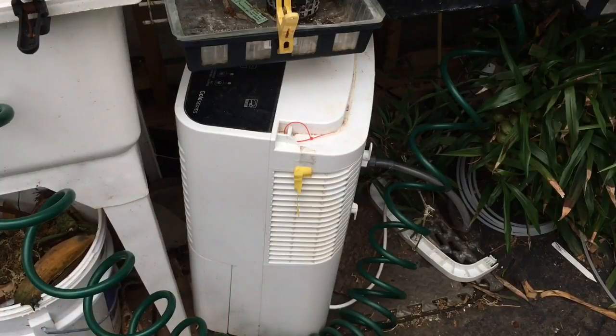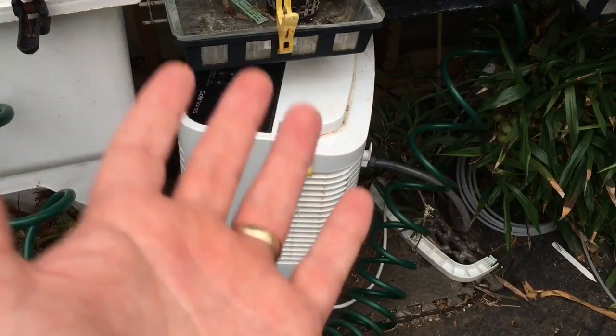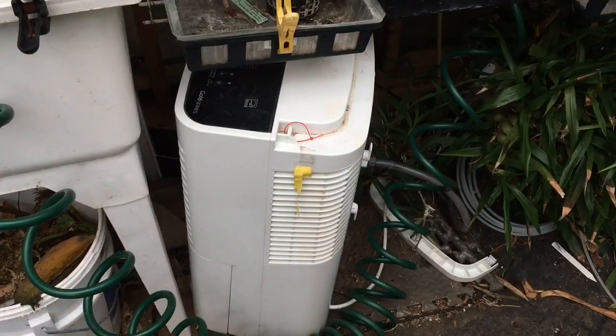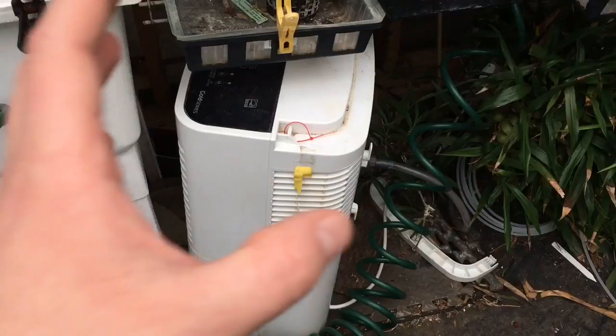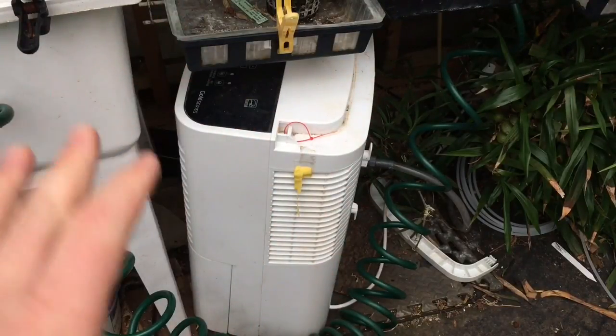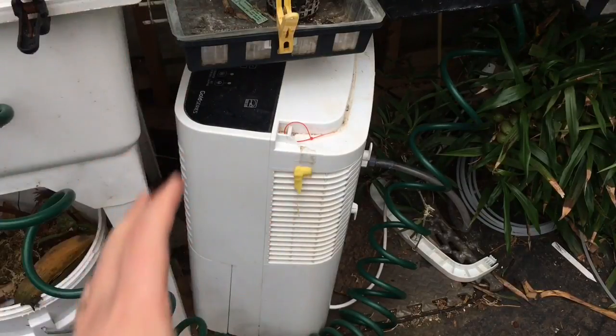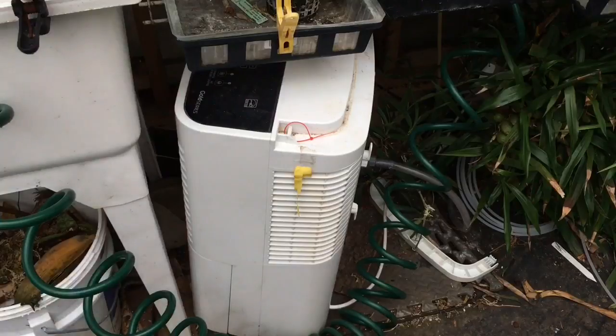But if you strip too much humidity out of the air in a home, it's going to be uncomfortable for you. The other thing is, the easier it is to grab moisture out. Like I say, it's humid in here still. The dehumidifier is set to 88%. When it's working with 88% or 95% humidity in the air, it can strip so much water out of the air, it produces so much heat. As the humidity drops, it has to work harder and longer to take out the remaining humidity, which means the air isn't as warm coming out.